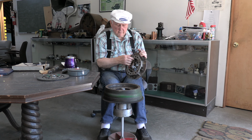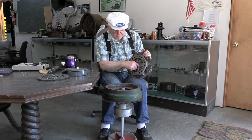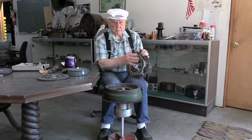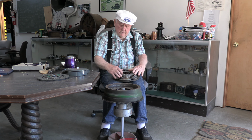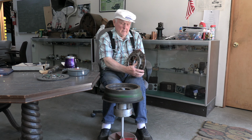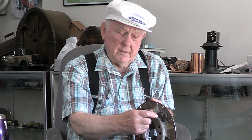They're held by this hole, which is concaved in, pressed in, so that holds the top of the spring, and there's a little foot on the other side that holds the bottom of the spring, and there's 12 of them. So they all have to be lined up at exactly the same, and then the nuts put on and hold it into place. So what happens is occasionally, if somebody uses a tapered screwdriver, they can break off the tip of that bolt. You can replace it, but just replace one at a time.